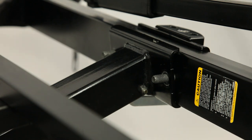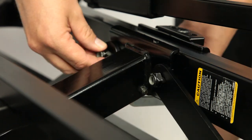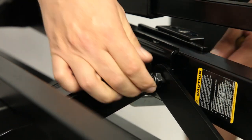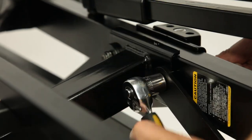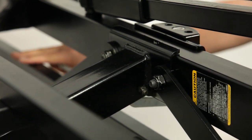On the back side of the bracket, where the bolts come through, attach the light bar brackets with the lead wire facing the vehicle. Install 17mm nuts and tighten with the 8mm hex key and 17mm wrench. It's recommended you look at the light bar to be sure it is level with the rack before tightening.